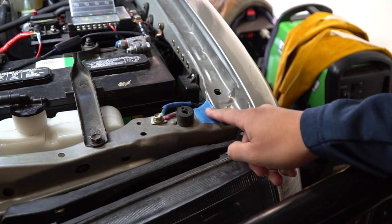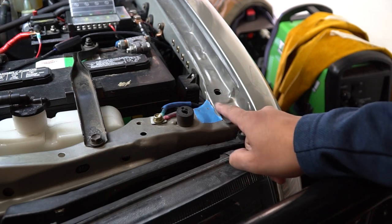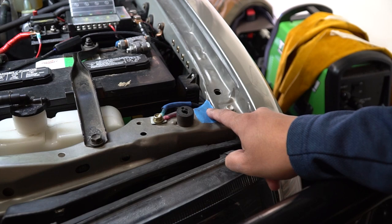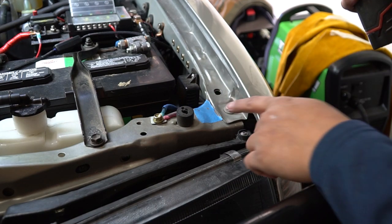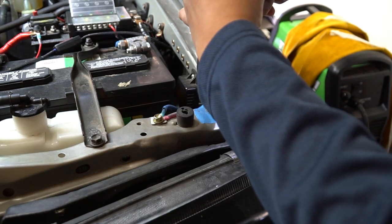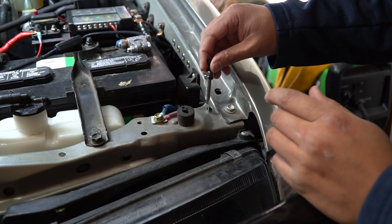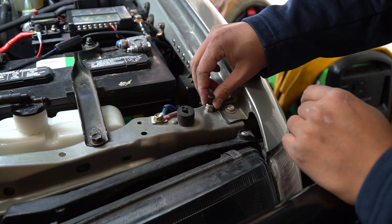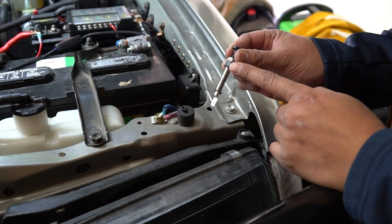For this next step, drill a hole right around this area — choose the flattest, most centered spot, and don't drill too close to the edge. Yoda Nation provides measurement ballparks in the instructions. We're going to drill out to five-sixteenths of an inch and install the hood pin. I already center punched it and will start with a small drill bit and work my way up. Make sure there's nothing behind the spot you're drilling. Once the hole is drilled, drop the pin in with a nut — you want to make sure it can still turn. Leave one nut on as a jam nut.